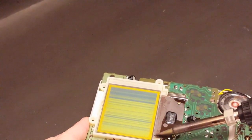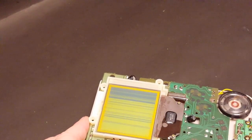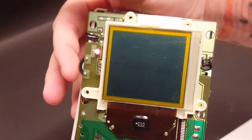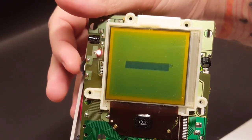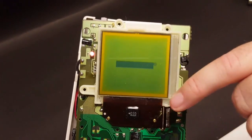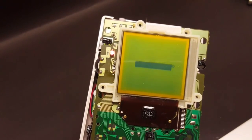You're going to turn your contrast all the way down so that you can see all black, and just start to go back and forth until you bring all the pixels back. I worked it for about a good 30 minutes and we were able to bring back all of those dead pixels. As you can see it's a completely black screen, and when I change the contrast — there's the bar right there. Fantastic. Now I'm going to let this set before I take the screen out to put the backlight in.